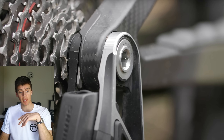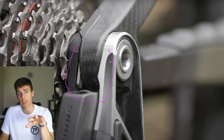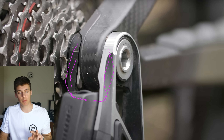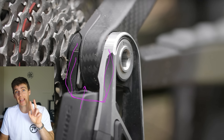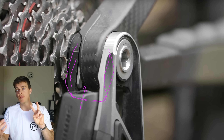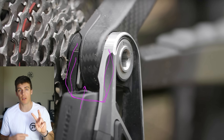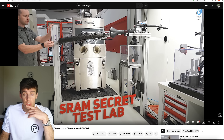Here's another quick picture of the clevis clamp arrangement. This plate and this plate are all one part — whether it's forged, machined, or forged and machined — that is a unified body which slides up over the dropout and clamps together. You need to take out that clamping clearance with the bolt load. Let's say you've got 400–500 kilograms of axial tension in the bolt; it might require 200 of that just to take out the clearance. All frames are going to be different — some thinner, some fatter.